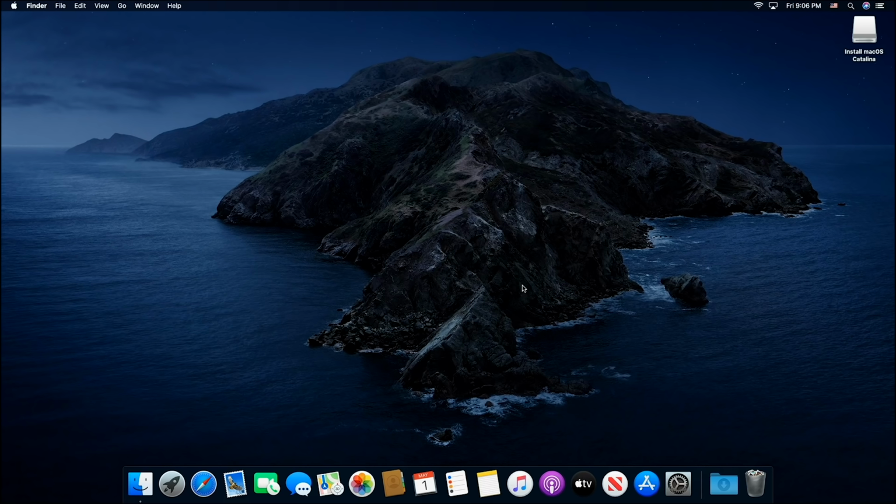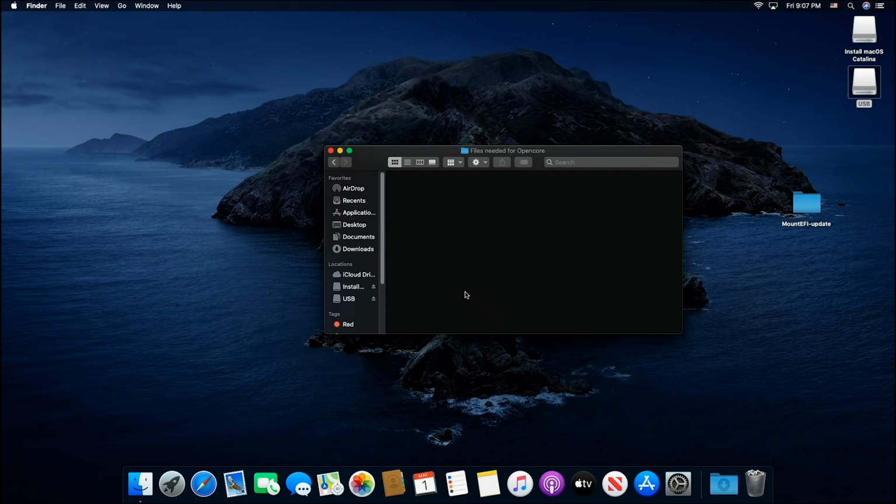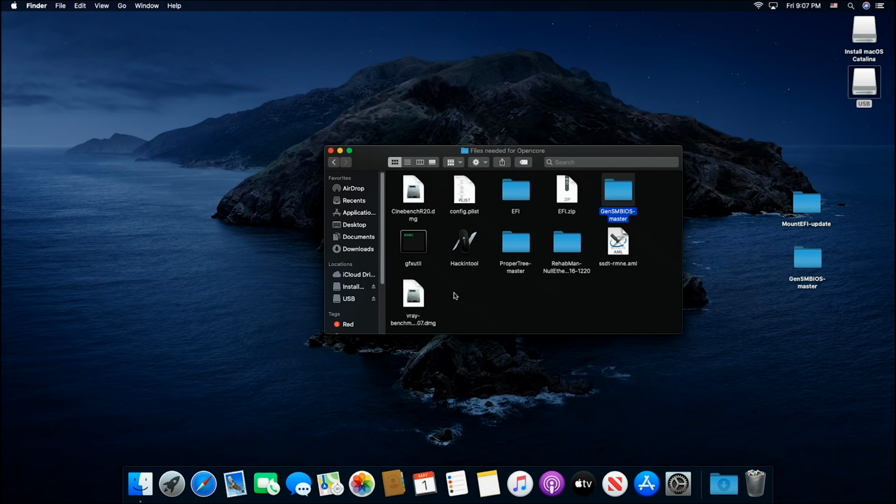Okay, now what you're gonna wanna do is go over to my website and download the files that are associated with this particular build, with this video, okay? I've got them on a USB stick right now, so I'll just grab that so we can continue this. There we go. So what we have to do right now, guys, is transfer our EFI folder from our EFI partition on our USB stick to the hard drive so we don't have to use the USB stick anymore. So I'm gonna need this Mount EFI program, and I'm also going to grab my Gen SMBIOS to change serial numbers, okay? All right, so I'm gonna go ahead and get rid of this.